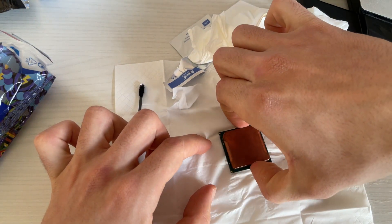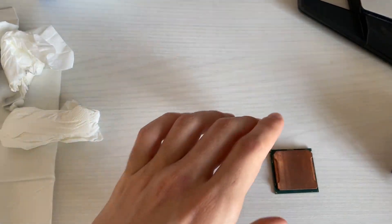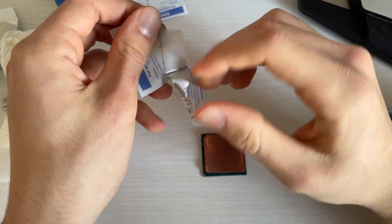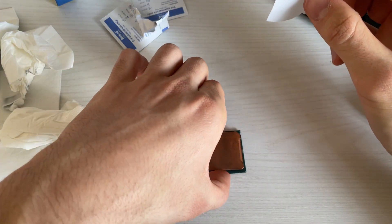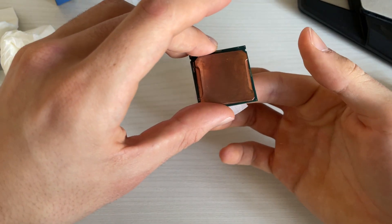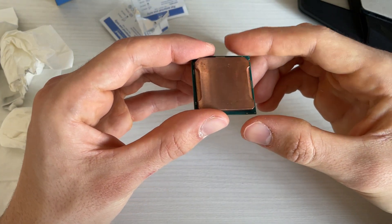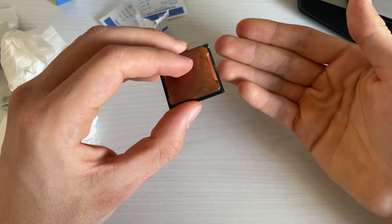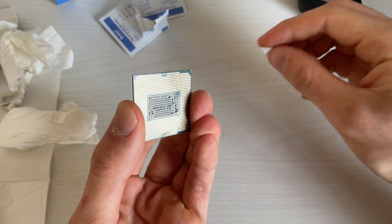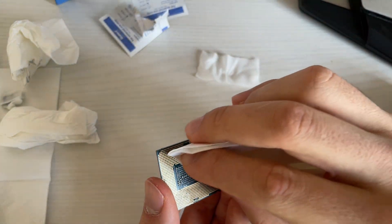Now we want to slightly clean the bottom of the CPU with alcohol. Let me slide this liquid metal mess to the side, get our CPU, and grab a clean alcohol wipe. Press the IHS — the surface contact will prevent it from opening — and use an alcohol pad to clean the bottom so there's no liquid metal down there. Double check it's placed properly, press it firmly. Don't worry about your hands touching the bottom of the CPU, that's the least of our problems. It's pretty clean with no liquid metal traces.